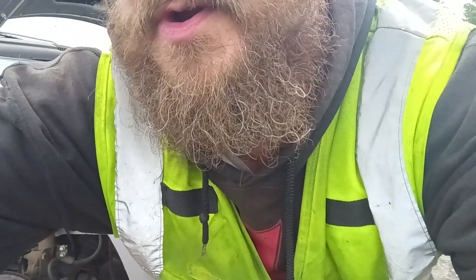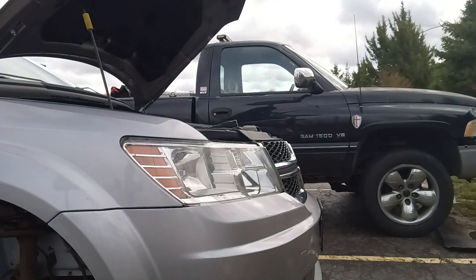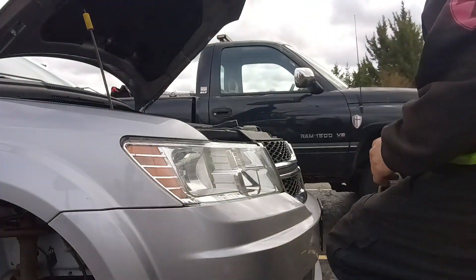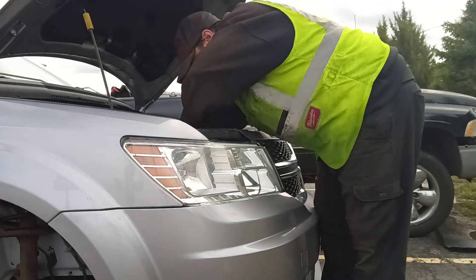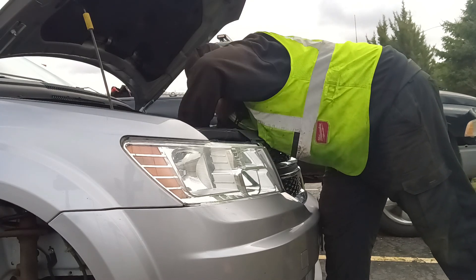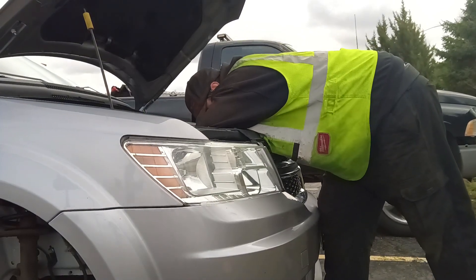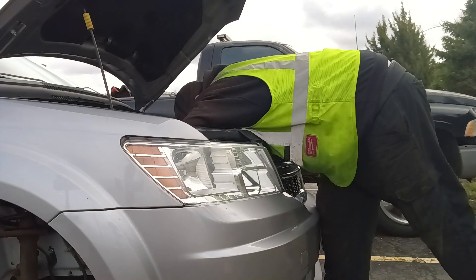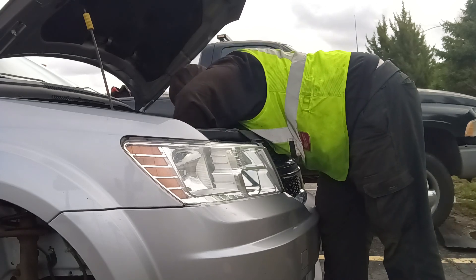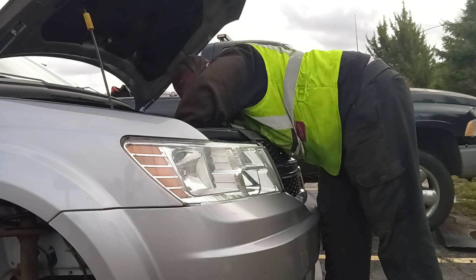What I'm going to do is go down here and get the bottom bolt and put it back in the alternator, so that way I could just set it on that lip and then worry about tightening it up later. First I've got to get the alternator in position. That's gonna be a problem — let me take this back out. We've got to move the piece on it so we can get it to fit into its position.